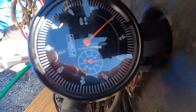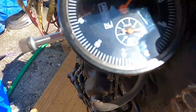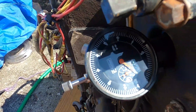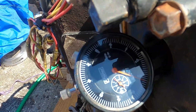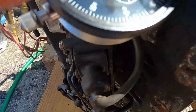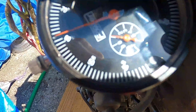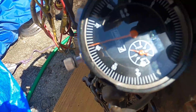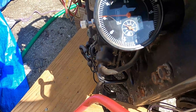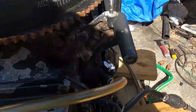Exactly zero — tighten it. So now the dial has turned five already, so now I need to go back counterclockwise until I get four point four six two. So go one, two, three, four — needle swinging past zero, that's one turn. There's six — six two will be like right there. You can see my indicator shows I'm down to one now, so I was at five turns, now I'm at four turns. Four six two should be right there. I can't get it to stay exactly, but that's okay for now.